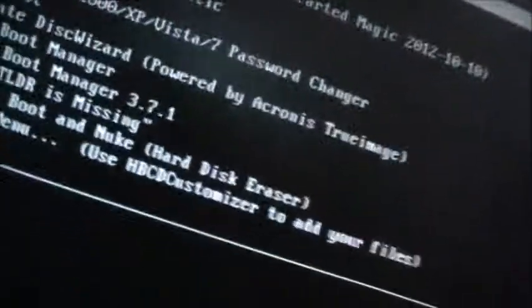Look at our viewers. Well, I did a Windows 7 clone to this hard drive from a 160GB Seagate that was in here. 40GB Western Digital. I want to try and retrieve the product key off it so I can reinstall Windows 7 and activate this machine again as it was before. Because a clone, a Windows 7 won't boot up properly. It won't boot up at all.